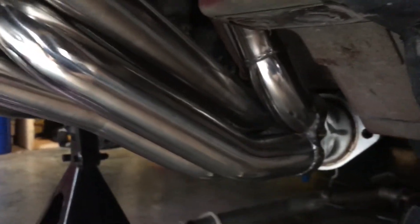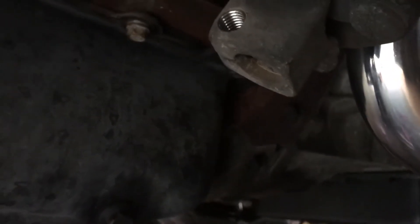It also fits my long tube MAC H-pipe. Perfect length — I may have to move it a little bit, but it's about exactly what's needed. So they will fit. If you're looking at OBX headers, 99 through 04, they fit. We haven't beat on a single thing. We may have to on that O2 sensor to get a little bit of clearance, but you can't beat that.